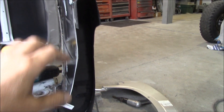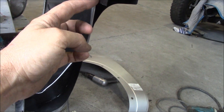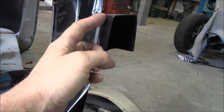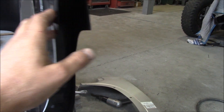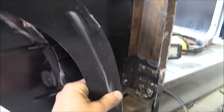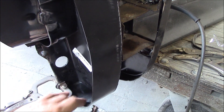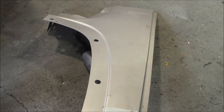What I've done is — it's a little longer than it's supposed to be so obviously I'm going to trim this back — but I've spot welded this panel on now. Your inner piece is all spot welded on. Then what's going to come next is I'm going to try and fit the outer panel on — that's the next step.